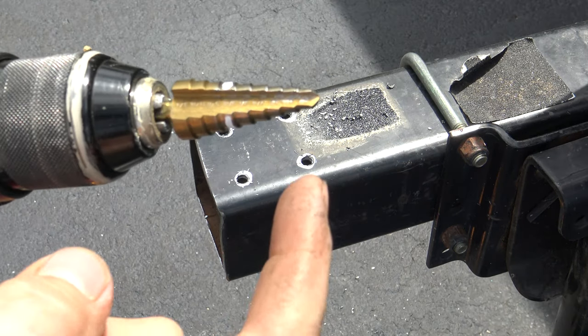At this point, remove the old safety chains. The new safety chains need to be attached behind the pivot point — about right in here. Go about one inch up, drill your half-inch holes, and install new safety chains. Once you have your new safety chains attached, it should look something like this — I just reused the safety chain bolt.